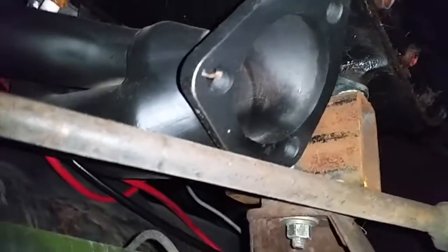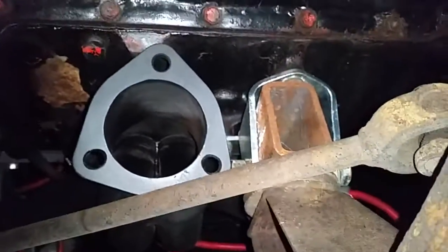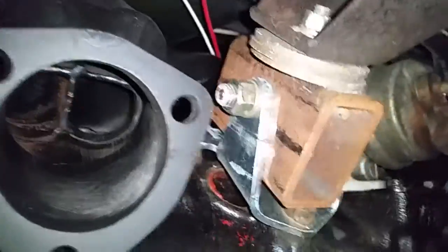Here are some of the issues you would encounter putting a Chevy 350 in a 240 Datsun. See the oil filter right there. These are block hugger headers. With that stack of washers I'm going to move to this side, moving the engine back an inch and helping with this issue. See that right there? That's the steering setup on this side — it's not too bad. But there's a starter right there, and the frame rails.